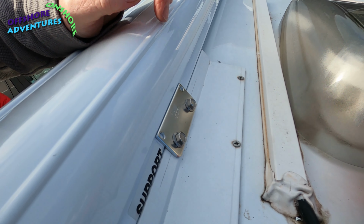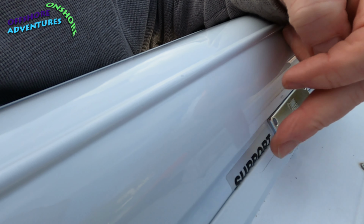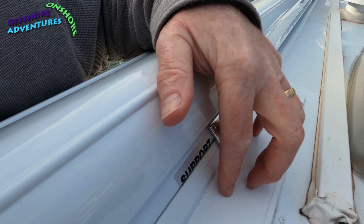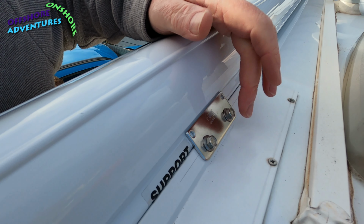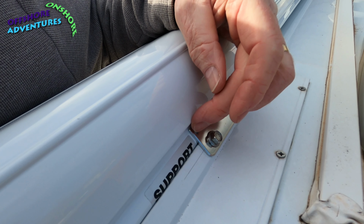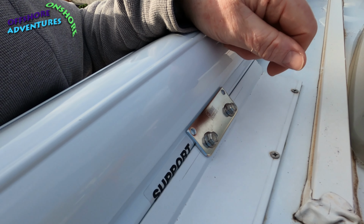Okay, so we've offered up the awning here. It's up on the van now. It's slotted into the slots here. That's the support stickers that they put at each end and in the middle. Their instruction is that the word support should feature on this bracket, so that you've got them positioned in the right place. As I say, these were put on by Marquis Motorhomes, so I was hoping they're in the right place, which they are. So there's the two, those are the M6 bolts now. They've gone into the M6 nuts that were slid down those channels, you remember, and then this is where the self-tappers now go. They've only supplied a single self-tapper for each bracket, but they'll go straight into the awning itself, the little 6mm jobs, and help to additionally secure it, as well as these bolts with the nylocks.